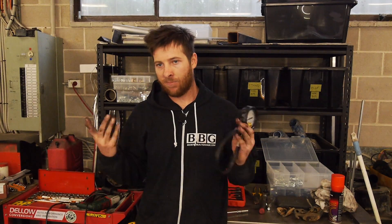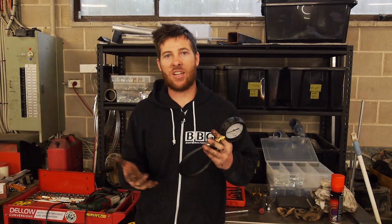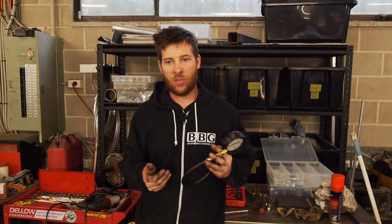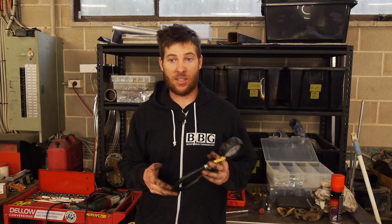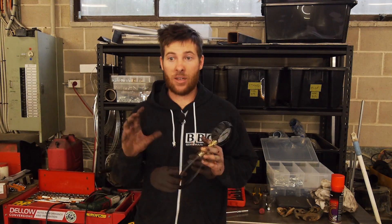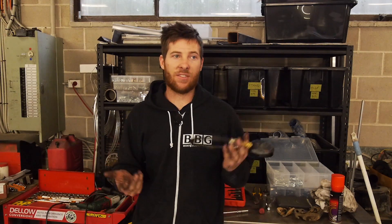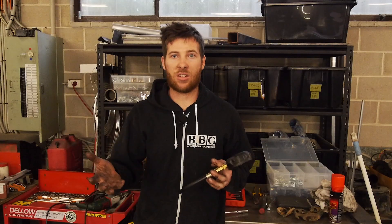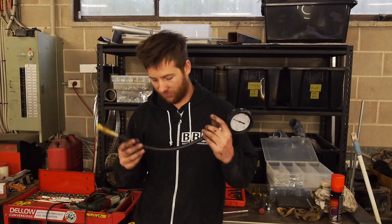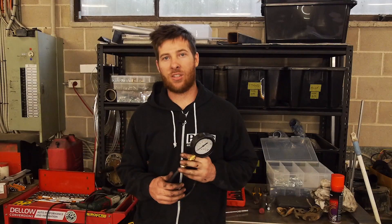For me, as I said, it was just a health check. I've done a lot to this car, but I haven't really touched the engine yet. I'm actually quite glad that the compressions are really good across the board — that's awesome. It's probably a good thing to do every now and then, maybe every 50,000 kilometres or so, or any time you change glow plugs. For the sake of $50–$60, it's good to have in the kit, especially if you're going to be doing a lot of work yourself.